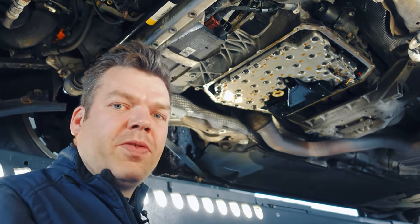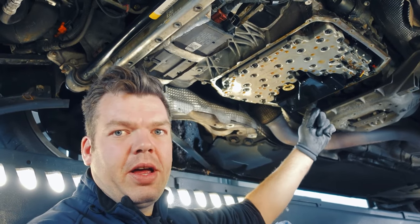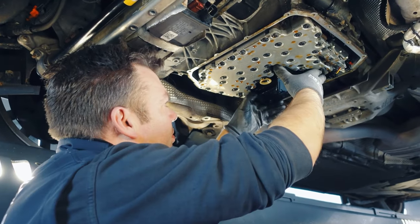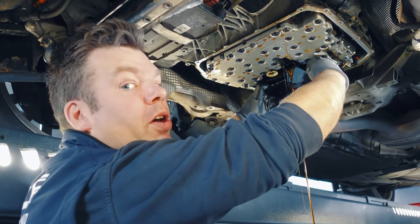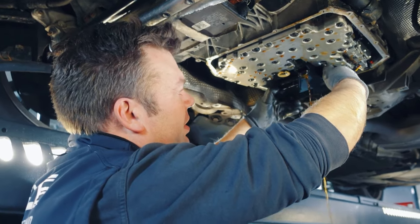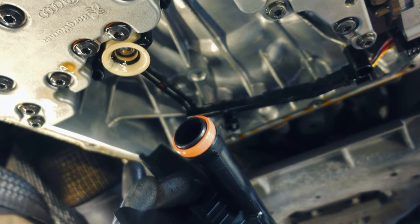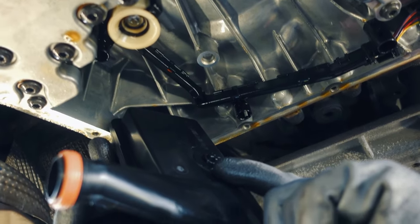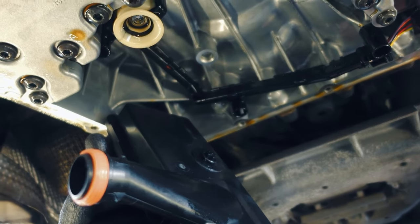Next, we can remove the internal filter. We have to be a bit careful because there's an electric wire on the back side that we should not damage. You can simply unscrew it towards the back — you can hear bubbling because a little residual oil still comes out of the mechatronics. Then pull it down. The connector pipe of the filter is pushed into the gearbox, and the filter must be pushed in at the top. There's a ring on the filter, but it does not have a sealing function — it is only there to ensure the filter sits properly.